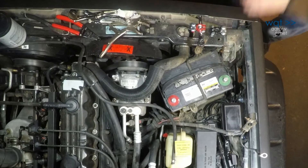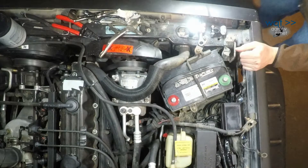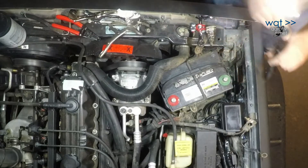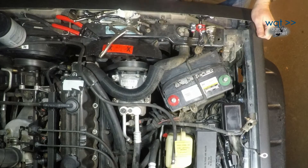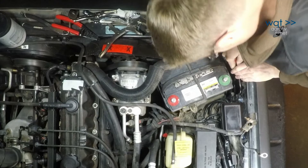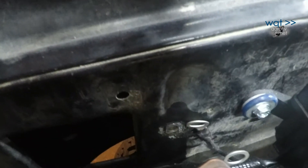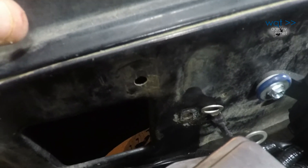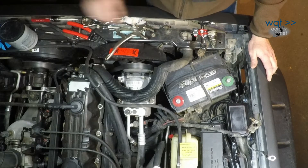Something I noticed about the body ground over here is that the paint has not been properly prepped around where the ring terminal sits. Obviously there's a giant bolt holding it, so it's worked up to this point and I assume it's going to work still. Although if I really wanted to be thorough I could take a screwdriver and clean that area — it's not strictly required, but it'll just ensure a good connection when the new ring and additional rings get compressed back on there.